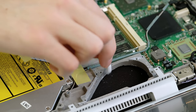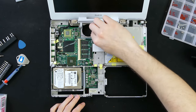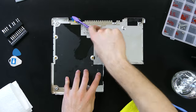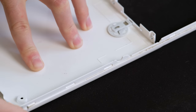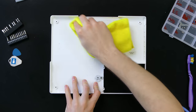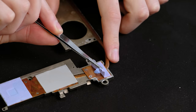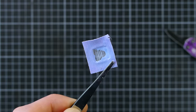Locally, there aren't any shops that sell thermal pads designed to transfer the heat of a processor. The closest thing I could find were 0.5mm thick at Jaycar, but these are not designed for this kind of use. Since I was running out of time and had a deadline to get this video done, I couldn't wait for new thermal pads to arrive from somewhere online. Using some isopropyl alcohol, I began trying to clean the surfaces of the metal shields. It looks as if the surfaces were more tarnished than rusted, so I don't believe they'll become much worse over time. Gaps between the casing have accumulated a fair amount of gunk, which was rather satisfying to remove. Some of this may be leftover polish from the cleaning I performed earlier. Internally there was next to no dust - maybe this laptop was used in a laboratory with a lot of chemicals.